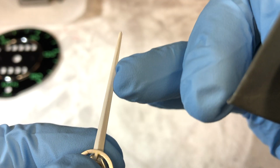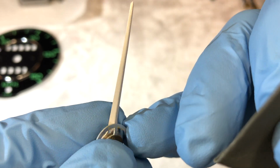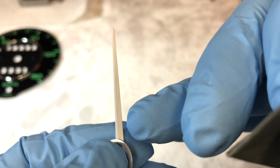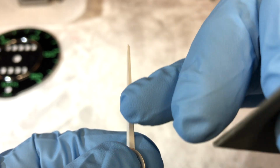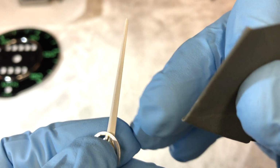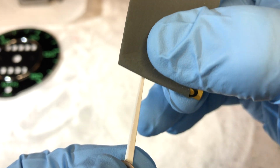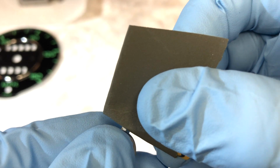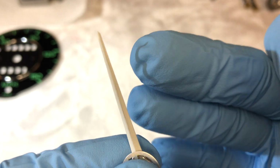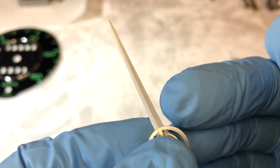So our first coat is just a brush coat of primer, and the reason we're brushing that out as opposed to spraying it out, primer is really a thick build type of a paint, and so if we just spray it out, it'd be very coarse, very rough, and would affect our finished coat on top of it. So if we just brush out a real thin coat of primer and then knock it down with some 1000 grit very gently, we'll be able to have a nice base there. But when we put our final spray out on top of it, it'll opaque out quickly and you won't have too much weight onto the needle.